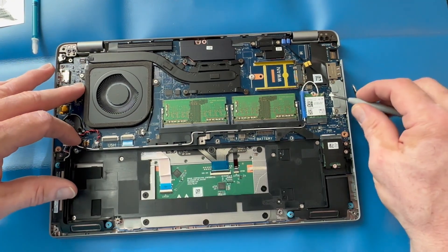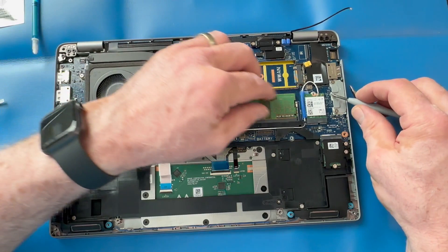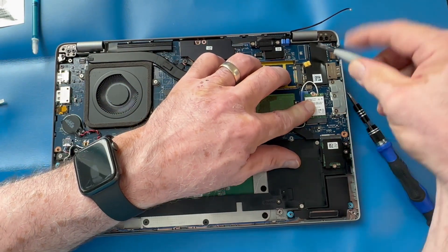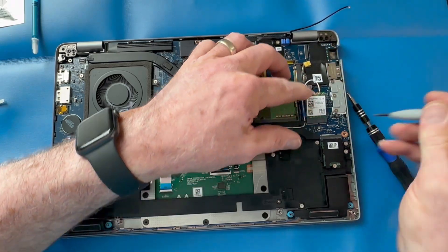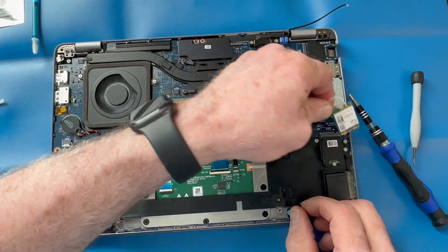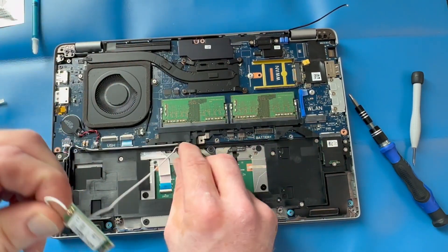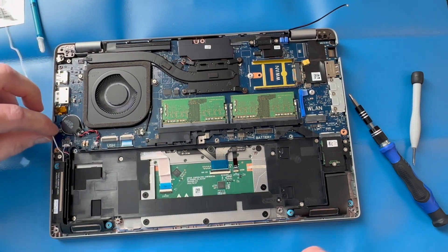This particular Wi-Fi card has two antenna cables — one going to the left side of your chassis and one going to the top, the black one you can see there. One of them has got to be disconnected. I'll try to keep the white one intact. Usually you have a little bit of adhesive underneath, so you have to pry that up before removing it. Just grab the wire and pull it out of the way, trying to keep the connection intact — it'll save you time later.